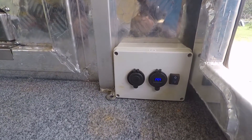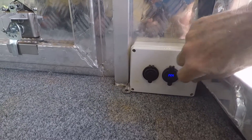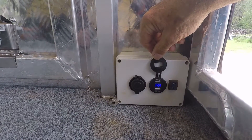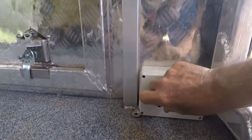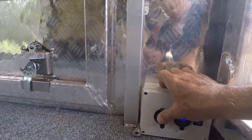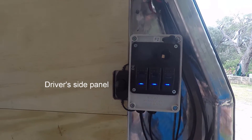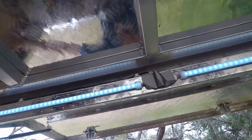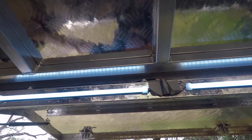This box in the passenger side corner of the canopy is marked f3. It has an on/off switch which is not currently used, a twin USB outlet at 4.2 amps combined, and a voltage readout currently showing 14.4 volts. It also has a cigarette outlet. F2 is the driver's side version with an interior light switch, and I'll just show you that.